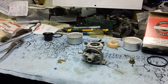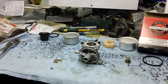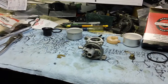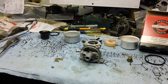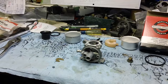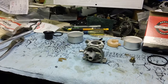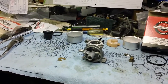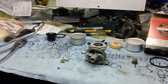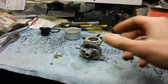We traced about a quarter of the problem down to the thermostat vane on the automatic choke system — that had to be replaced. The other issue was the carburetor itself had a bunch of sediment in it, and the air box was leaking. One of the bolts on the carburetor was not tightened. The plastic intake manifold looks like it might have been a factory design issue, because those things had to be extremely tight to have a nice perfect seal where it goes to the carburetor.